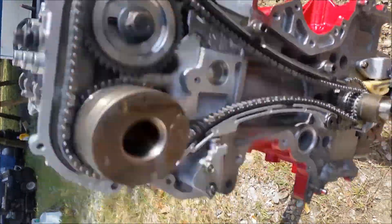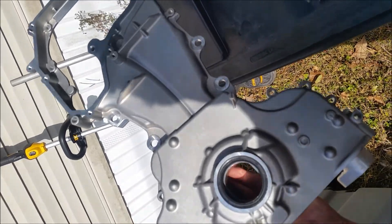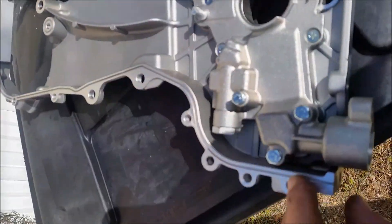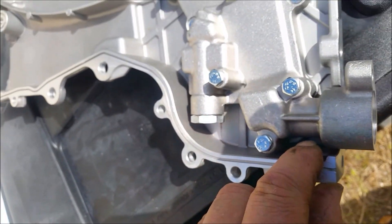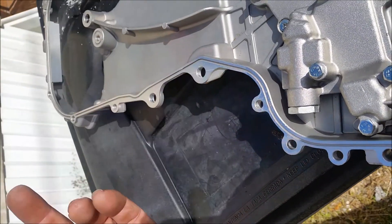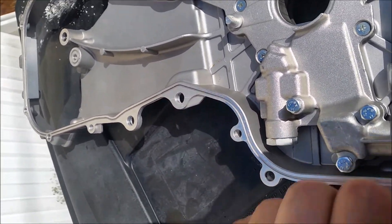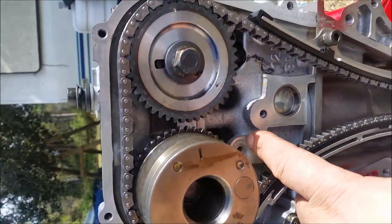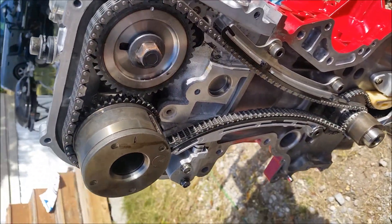When you put the cover on — I got a nice brand-new cover; the seal's already in, which is good because the oil pump is in there so the whole cover comes with it. I'm just going to put a bead of silicone in here, just enough that when it goes on it doesn't squish inside the engine. If it does, you get little flags of silicone that can break off and end up in your oil pump pickup. Put enough but not too much. There are also two O-rings — put a little grease on them, stick them in, put silicone on the case, put the case on, and torque the cover down.